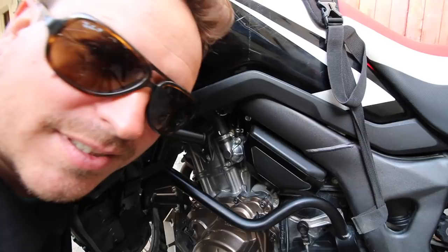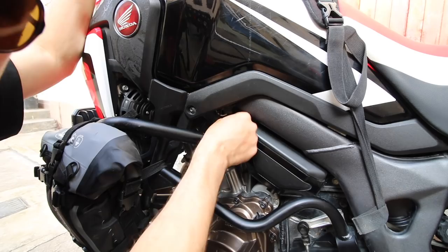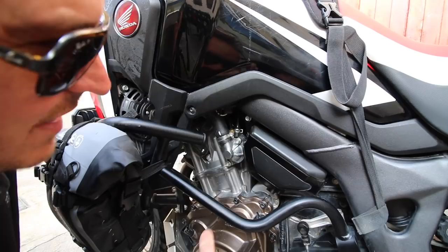The infamous airbox drain collecting plug things — check them out right here on the left side of the bike. There's one that you have to open and drain, and then another one that you have to open and drain. A piece of advice: don't try to put a cup under them; just open them and put a rag under it. About a tablespoon of anything comes out of there. My theory is that it drains the oil out of the airbox because overflow oil goes into the airbox.